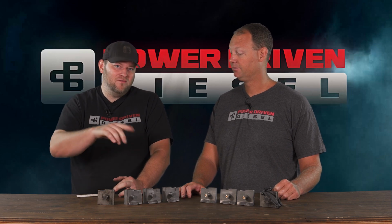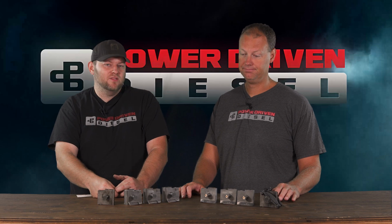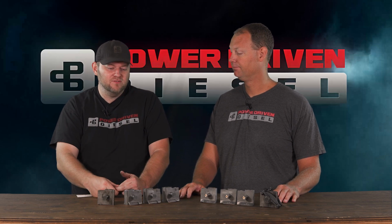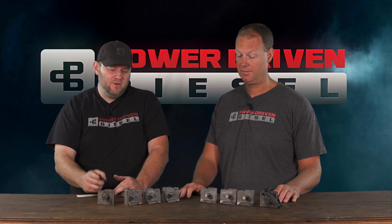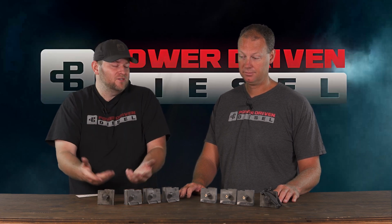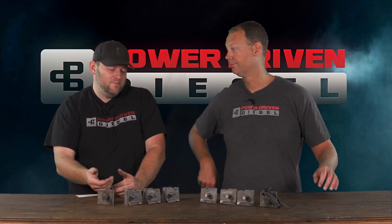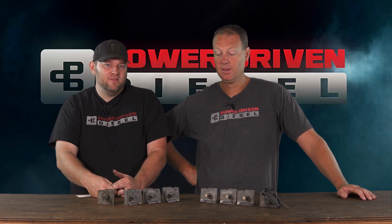If you have a race truck, it's side loading the valves, wearing out the guides. That's the big advantage you see on the roller rockers: they don't side load the valves as much, especially when you get a big lift cam. But they're totally fine on a street truck as well. No problem. The factory rocker arms work great on street trucks too. But if yours are galled and all torn up, you might want to upgrade.